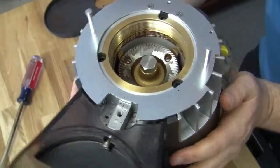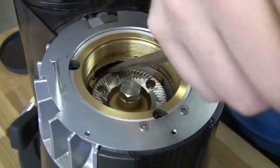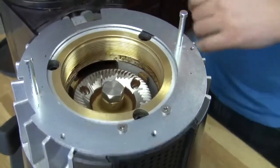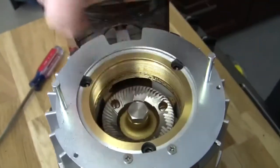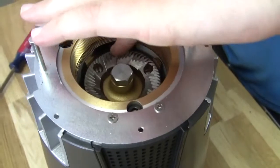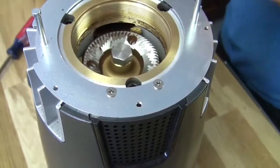The other thing people always forget about is this little chute right there. It's just the forgotten part, but it's the most important part because that's where the coffee exits. You can actually see it underneath here. That's the hold-back chamber — it's about from here to here. Ideally we want to try to get as much of that out because if it starts hardening it's going to start constricting that chute, which impacts the flow rate of your dosage. Everything is based on that flow rate.